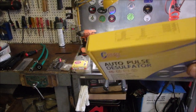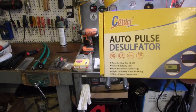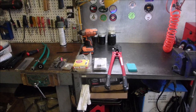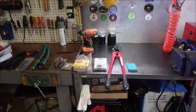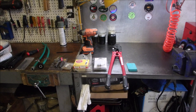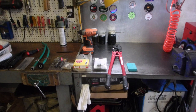And I did just what Klaus told me. I used it the first time and I wasn't impressed, but he said, no, put it on there until it drains the battery to the point where you get your low battery alarm or low something, right? And then I charged those batteries back up with my charger. And those two batteries, one is 12 years old and the other one is 9 years old. And I just took my bigger of the two for the twin cylinder John Deere LX178 made in 1996, and I ran the tractor dry last year, and I put that battery in there, and I was watching the clear fuel filter, and I had to turn it over for 20 or 30 seconds, and if it's a bad battery, it won't do that, and as soon as the gas hit the filter, whum, away she started. And that's on a 12 or 13 year old battery for agricultural gardening. And you know how badly those things are abused.